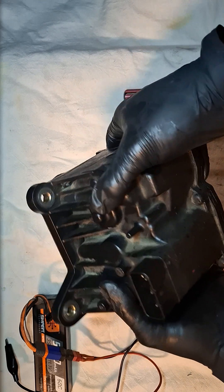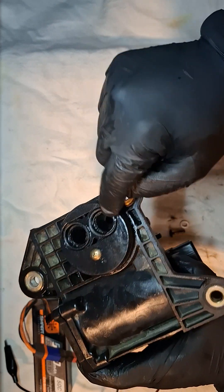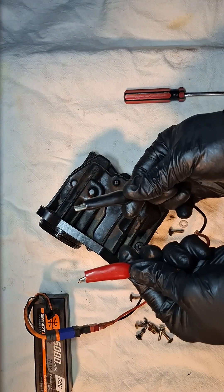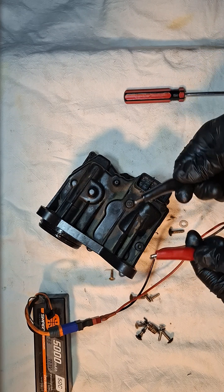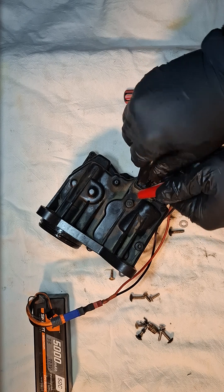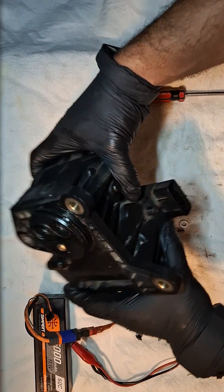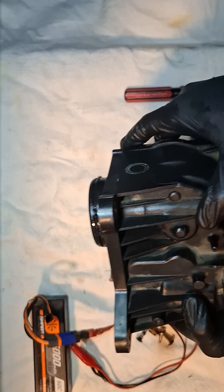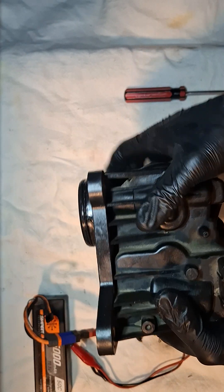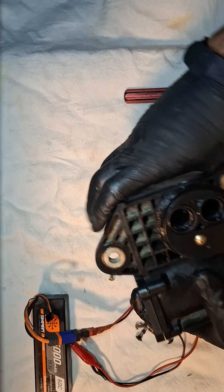When you take it out it will be stuck and won't come out. The reason is the center lock will be engaged. The best way is to get a 12-volt external supply — a 9-volt battery will do the job — and apply positive and negative, then negative and positive. You will hear the motor reversing everything back and then it will come out smoothly. Try not to wiggle it too much because you might break the teeth inside.